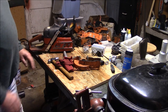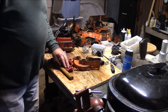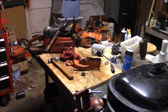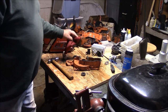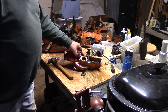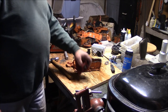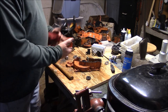The whole idea of using hammers and presses — while they get the bearing in and out — you're adding a discontinuity in that bearing pocket. You can add a problem you don't even know you have until your saw comes apart. So over the years, starting with motorcycles and moving forward, I developed a technique that was actually instructed to me by a fellow named Ralph Spencer about using heat differential to remove bearings from soft metal cases. The aluminum or magnesium expands a little bit faster than the steel, so you get to a certain temperature where there's been enough differential in expansion and the steel will release and come out or go in.